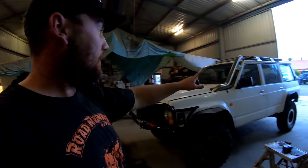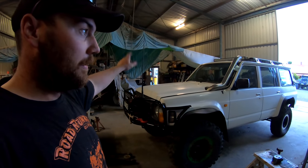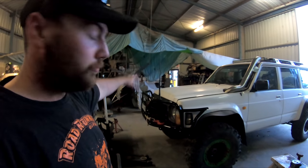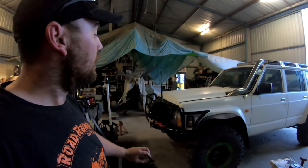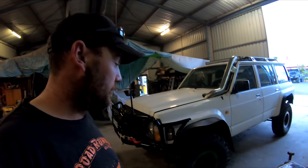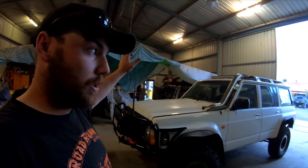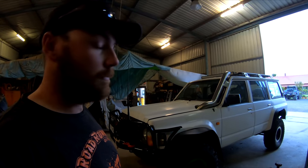What I'm going to do is back this out of the shed. I don't have a shock on the other side - I've just got a motorbike tie down there, and I've just limited it to where full droop would be: 30 inches eye to eye is fully open. I just had it down, measured it up and tied the motorbike tie down up. I'll back it out, lift it up with a forklift, lift it up, go left hand down, check for clearance, and we're pretty much sweet.